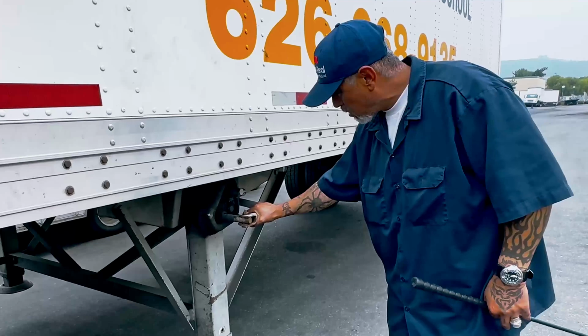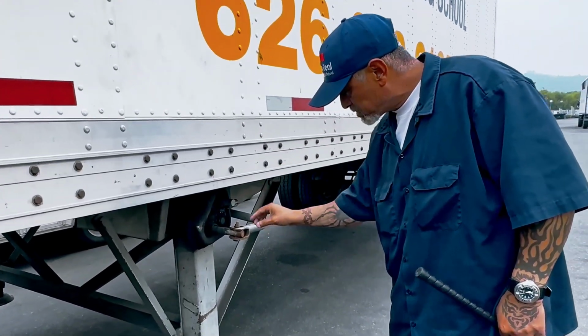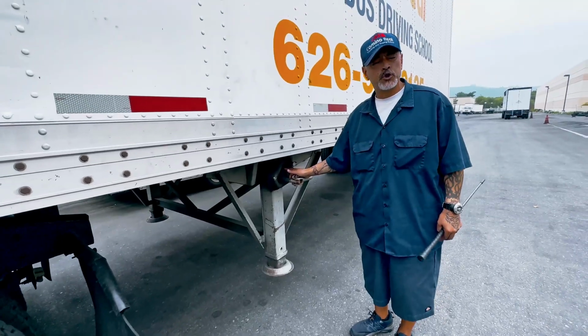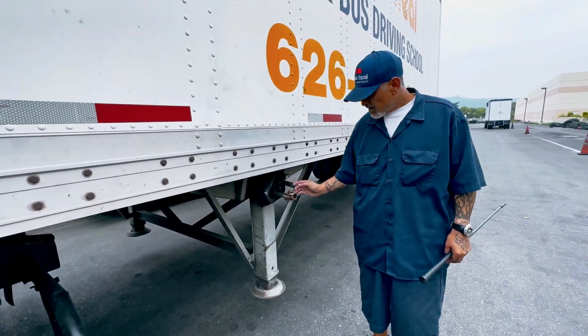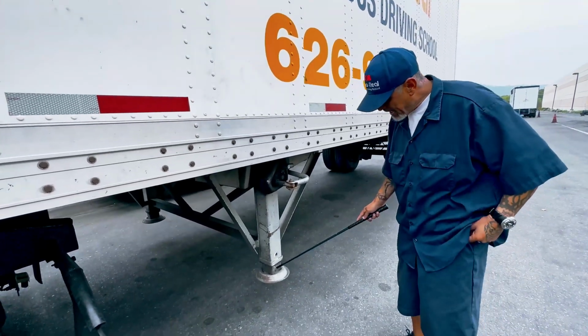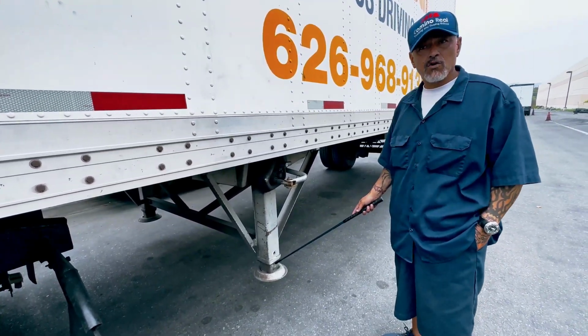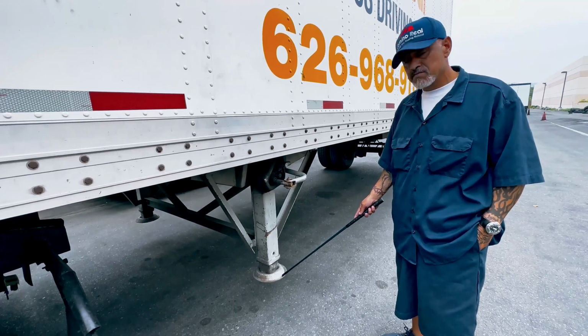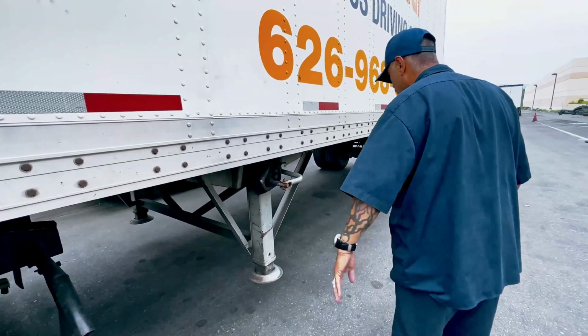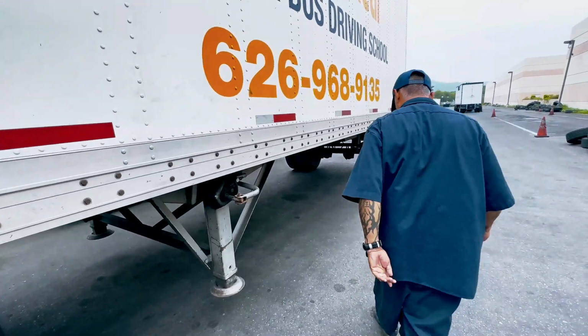This is my crank arm. It should not be cracked or missing, bolted tight and secure. It is gear driven, 2-speed, a high and a low. These are my legs, well greased, no cracks or illegal welds. These are my feet, no debris, no cracks, and not missing. Now I'm going to move on to the rear of my trailer.